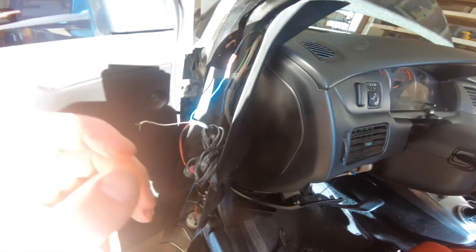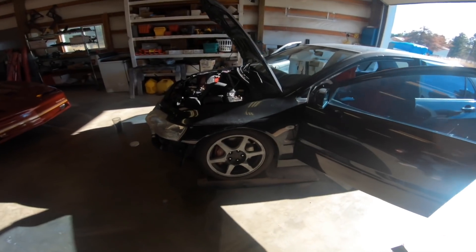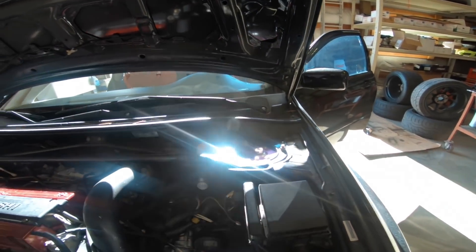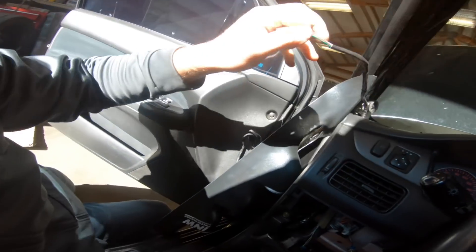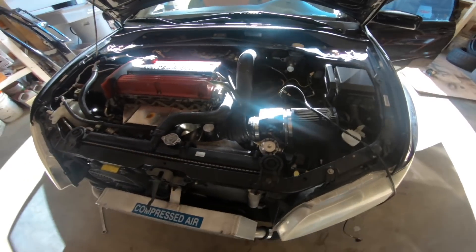All of the wiring should be ran now — we got the blue wire extended through to the glove box, we got power, we got ground. The very last thing to do is run this long harness from the AFR sensor on the downpipe all the way to the gauge through the firewall. Whoever had this car before me already drilled a hole through the firewall, so I'm just going to run my wiring right through there. Other people online say there's a rubber plug on that side or a rubber grommet through the fender you can use. I have that wiring ran from the back side of the firewall — now I just need to plug it into the back of the gauge and into the sensor.